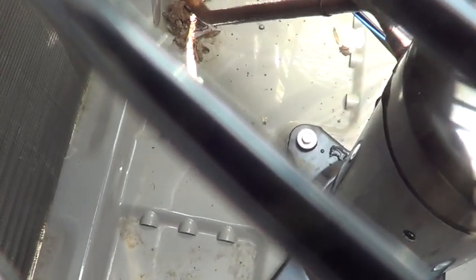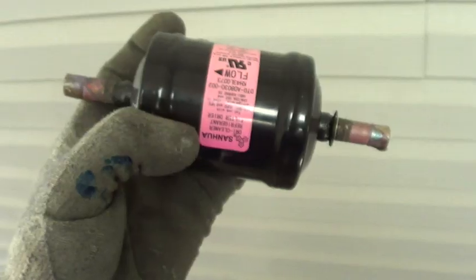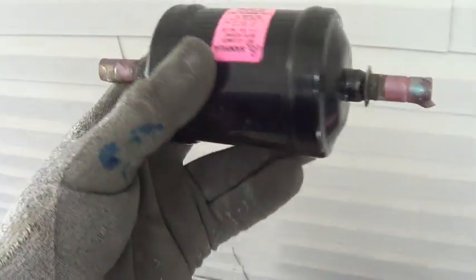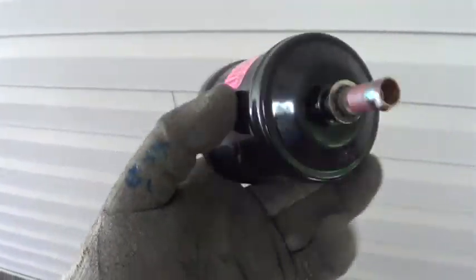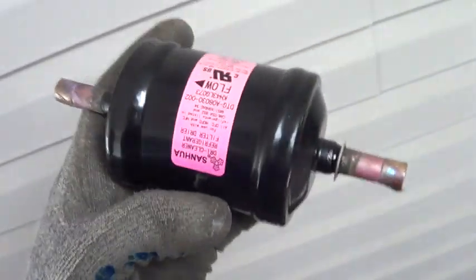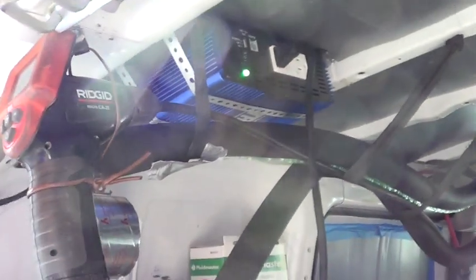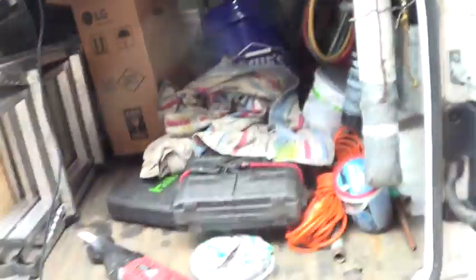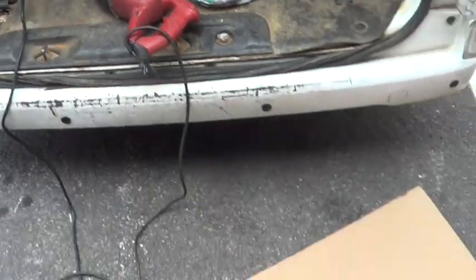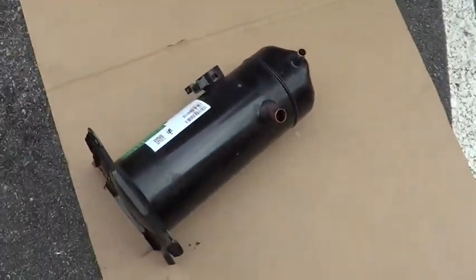These LGs definitely want high superheat. I can easily blow through the filter dryer, so it did not clog up with pieces - there was no self-destruction of pieces in this compressor. I've got my 2000-watt AC inverter with monster cable going to my golf cart battery and my sawzall. Let's open this bad boy up.